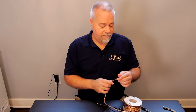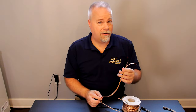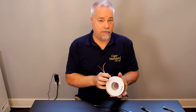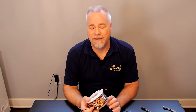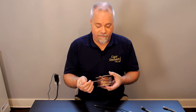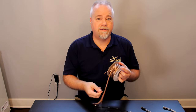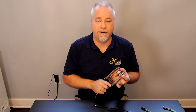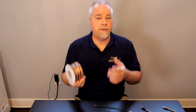So how do we get rid of it? With speaker wire, it's all about physical movement — you just have to get things far away, get the run as short as possible, make sure you don't have extra wire that's looping. There's not a whole lot you can do. Now, the pros of using speaker wire connections on your subwoofer: you're going to see these on basically the bargain-basement subs, the entry-level stuff. It's made for entry-level equipment. If you have just a two-channel stereo system, you don't have a sub-out, you don't have surround sound, you don't have an LFE channel — you have no dedicated way to connect a subwoofer. You can do it through the speaker connections on the subwoofer.